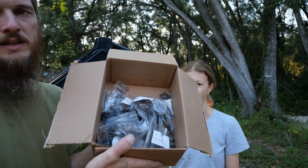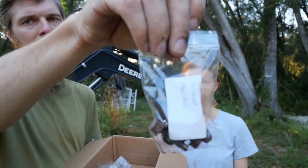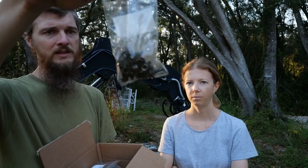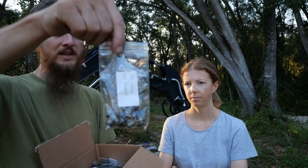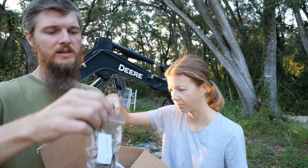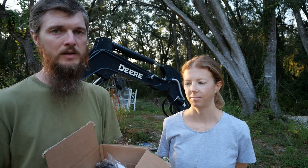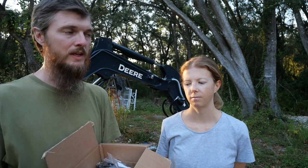You see, we have a box right here. And basically, as we take each piece apart, we bag and tag. So this one says exhaust manifold. Here we have the fuel rail, oil pan, washer container, that's the washer fluid container, air intake bracket, just everything we have right here, headlights, center console. That's all we do. We put it in bags, we mark it, we keep track of it. It makes reassembly so much easier. You can just grab the bag you need for the item you're working on.